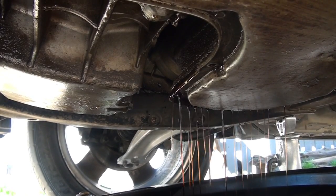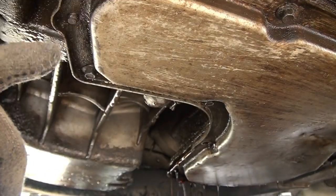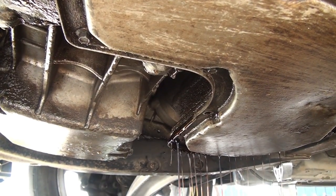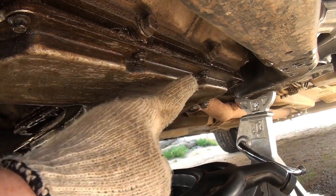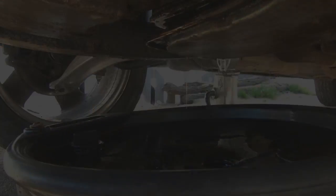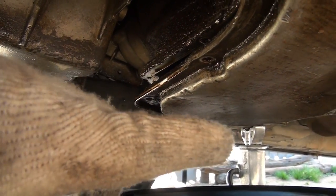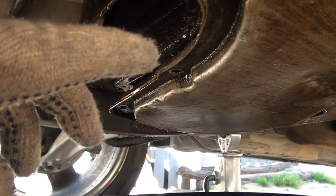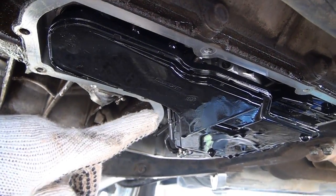Okay, I'm saving these screws up here for last and that pan will get a good gap down there and drain even faster. The more I loosen these screws up here, the more of a gap I'll have on the pan right down here and the fluid will drain out. One other thing — if you find your pan is not dropping down like this, then you may have left a screw in somewhere, or the pan may be stuck, and what you want to do is take a screwdriver and carefully pry it down.